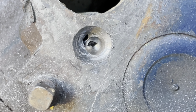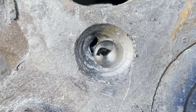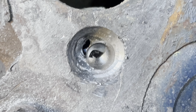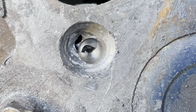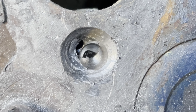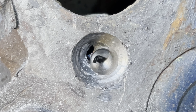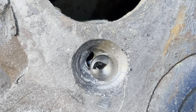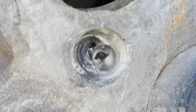Using the die grinder and the little itty-bitty ball, because we know we have to put a big old Timesert in there anyway. I'm actually able to get at the sides — you can see it — over the bit. So we're getting there. Maybe be able to push through that, break her up, and then drill.